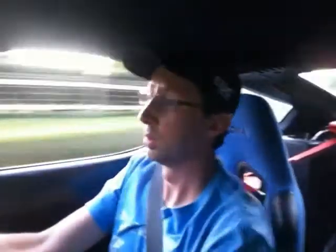Righto, still playing with jetting and trying to get a nice mixture. I'm starting to rev it a bit more now. You can really feel the cam. So 3,000, still a bit lumpy for 3.5, 4. It just smooths out, it just starts to drive really smooth and just wants to pull really nicely. So obviously the idea is to keep it in the band between 4 and 7. Sounds good to me. Not on these roads. Feel the cam, that's for sure. There it comes.